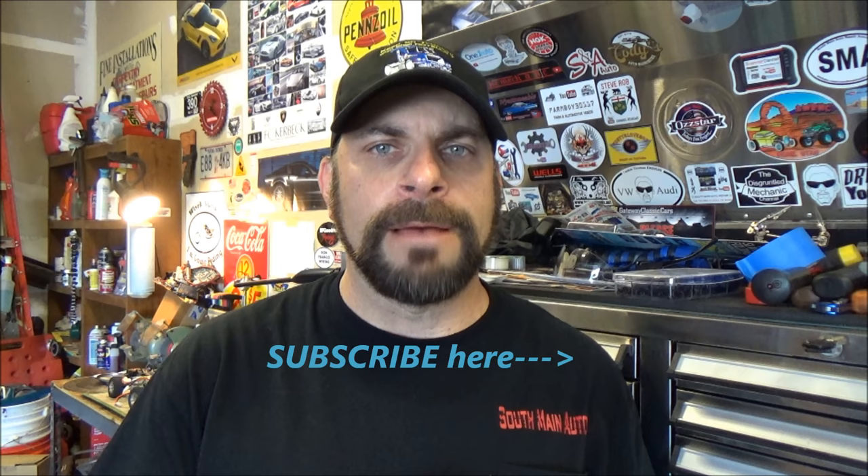I hope you enjoyed that quick one. It's pretty simple — just make sure that when you're doing a brake job, you check those pins. They need to slide. If they're not sliding, they're frozen, something's wrong. That also applies to the rear brakes. Thanks for stopping in — I appreciate your time checking out the channel. Subscribe, comment, like — all that stuff below helps my channel grow. I'll see you guys on the next one. Take it easy.